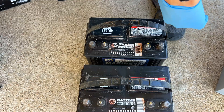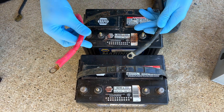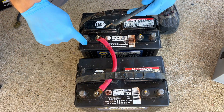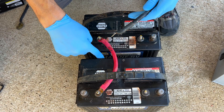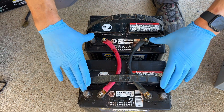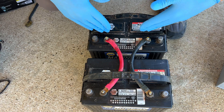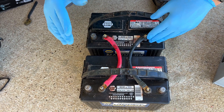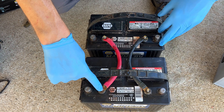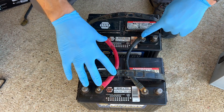Inside of our RV, we'll have some battery cables. We're going to parallel the batteries together — positive to positive using red, and negative to negative. Now our batteries are parallel together; we have 12 volts in, still 12 volts out in the whole system. Then we'll take our RV wires — positive from the RV goes to this battery, negative from the RV goes to the other battery. That way it evenly takes power out of both batteries.